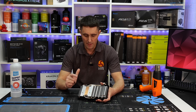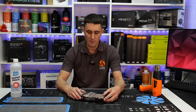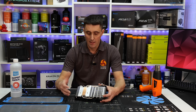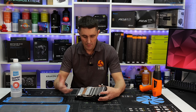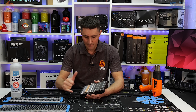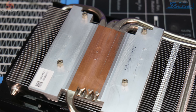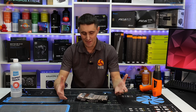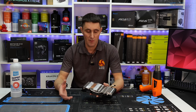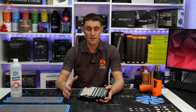When I first disassembled the card, I did notice on this cold plate there's a little bit of what looks like corrosion on the heat pipes. At first I noted it but didn't pay too much attention to it. So when we realised that the repaste and the cleanup hadn't solved the problem, I disassembled the card again — just in case I'd got a bad mount or the thermal paste hadn't spread or I hadn't tightened the screws up enough. The second time round, you could see from this bit of corrosion on the heat pipe there was actually a little droplet of water coming out, resting on top of the heat pipe, and there was a little droplet of water on the GPU die. You don't want any fluid or liquid inside the heat pipes resting on top of your graphics card — if there's enough it could spill over the sides and cause a short.